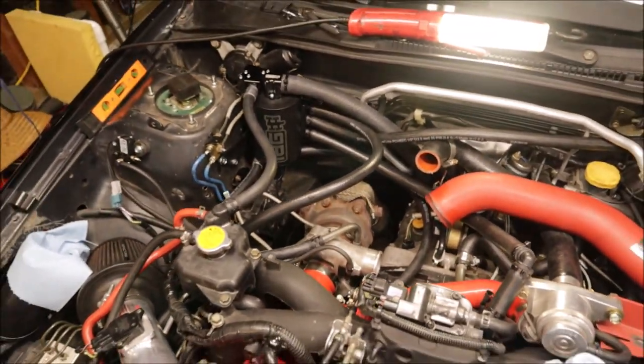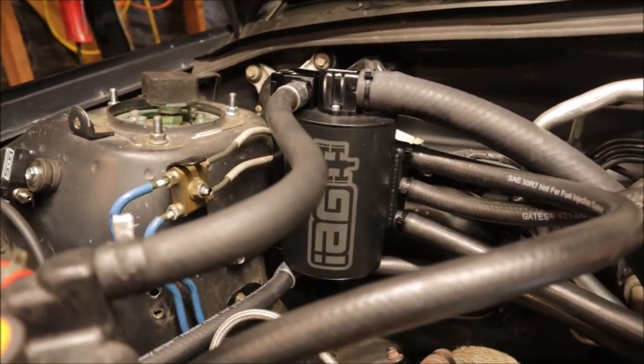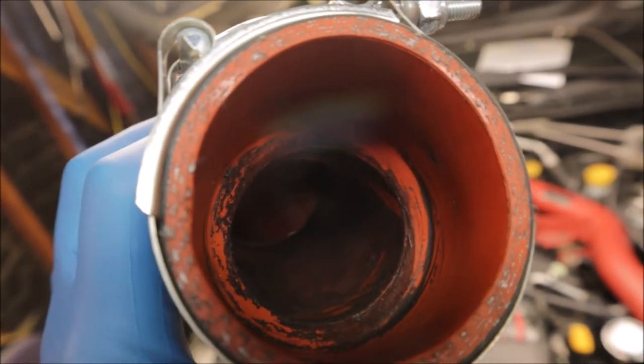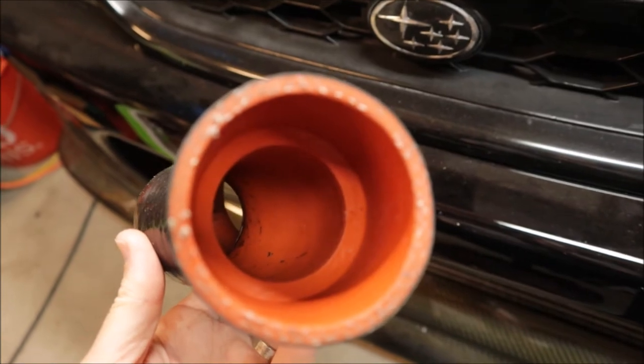For the second time, the air oil separator is officially installed — and it's not pretty at all. There are hoses and pipes going everywhere: seven hoses total, five air hoses and two coolant hoses. But function over form in this instance — we need it. Case in point: the intercooler piping I had to remove had oil inside it. No oil in the intercooler itself, which is good, but there were vapors and gunk built up. The hose coming off the turbo right into the intercooler piping was just filled with crusty built-up oil — years of vapors sticking to the sides. Threw it in a bucket of soap with a little degreaser, cleaned it up. That is the whole point of the air oil separator: to separate air and oil vapors so they don't recirculate back through your system.